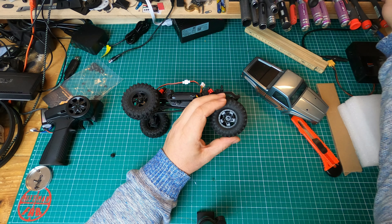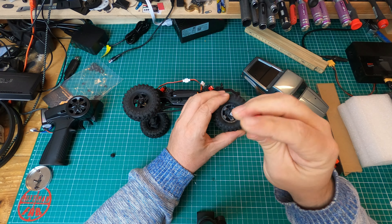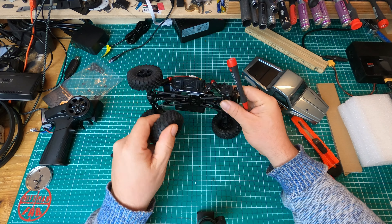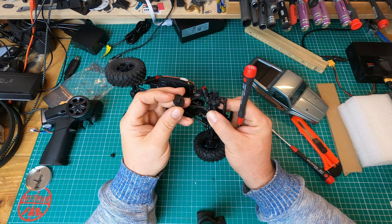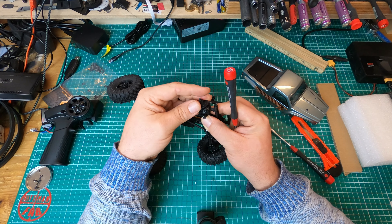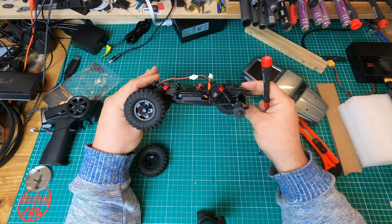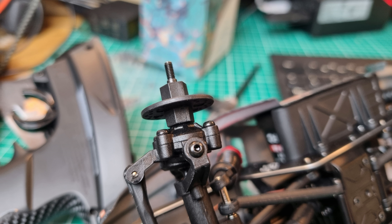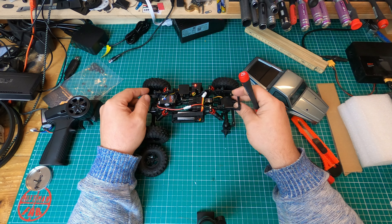Let's take one wheel off and check why the wheel is so wide outside. It's a five millimeter hex, and you can see this is a very wide hex. It also seems to have longer shafts than on the FX1 18 — not sure I like this. I want these cars to be as narrow as possible, because I sometimes drive competitions with friends and it's a real disadvantage if the car is wider since the gates have the same width. We can change these extra shafts for sure, so it's not a big deal, but generally it will increase slop. I'm not a fan of these extensions.